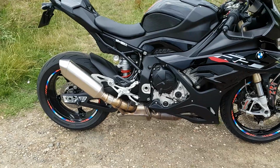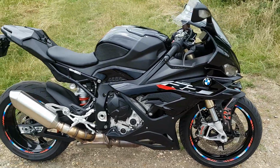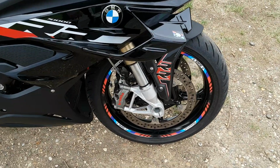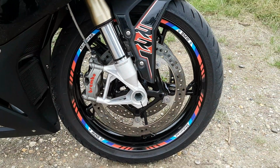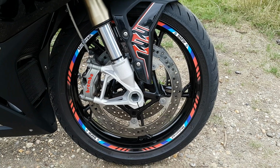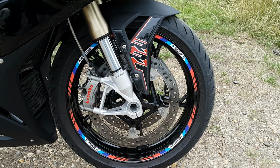Anyway, I've had to take the wheels out, and guess what? They're out of balance. The front one had no weights on whatsoever, and needed nearly 30 grams of weights. That was the biggest problem, I think, was the front. It was juddering so much.